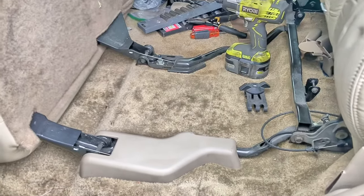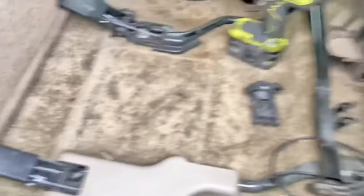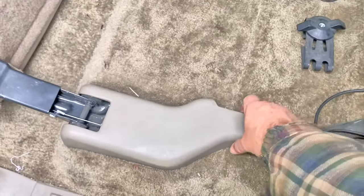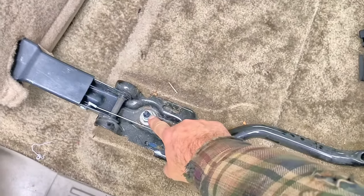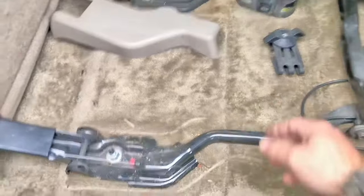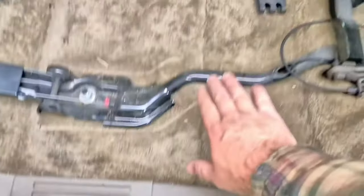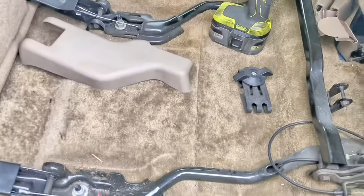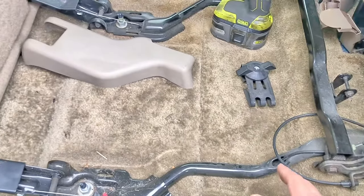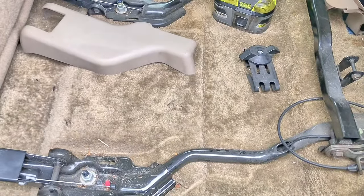Okay, I flipped the back seat forward. The fuel pump is basically right in this area right here. So all you need to do — these covers, they just pop right off, no tools required. We're gonna remove these four nuts: there's one there, one there, one back here by the seat belt, and one right underneath there. Pull this seat out, just flop it in the back. The carpet seamed right there which is nice, and I'll probably pop this trim out as well. Flip the carpet forward and backwards and we'll have access to the whole floorboard area. There's some spot welds on the floor that's a great reference point to measure off of to make the access window to the fuel pump.